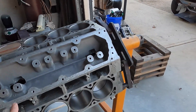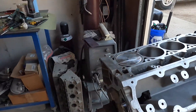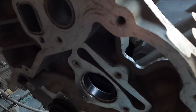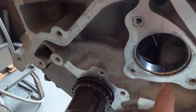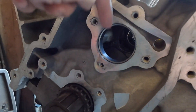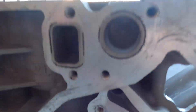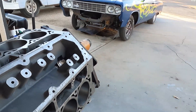I had four of them that I had to redo, so we were batting 50%, but now they are 100%. Then somebody else said something about my cam bearings - that you should be able to see the main journal or whatever - but that is not the case. There was only one hole; it's a slot in here. Conventional, I believe, is that way where you can see the mains. There's a hole here, so I do believe these are fine. Now I know that all of these guys are good.